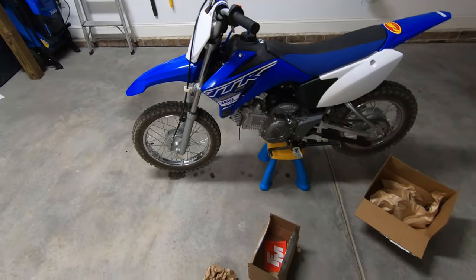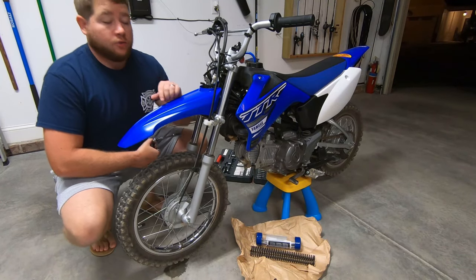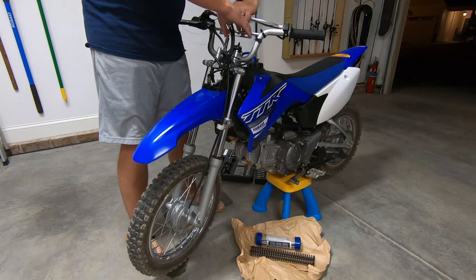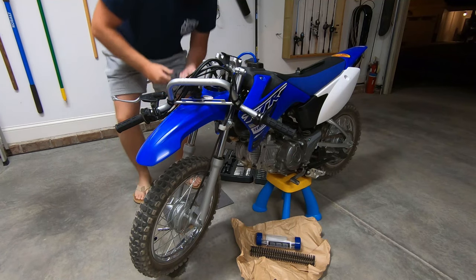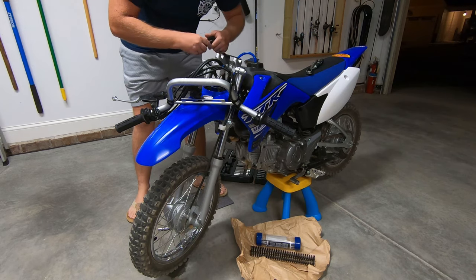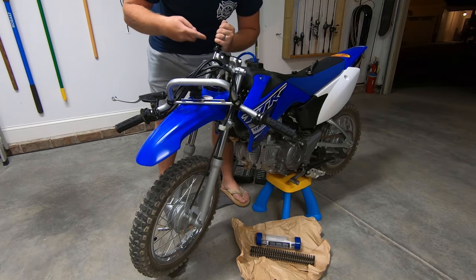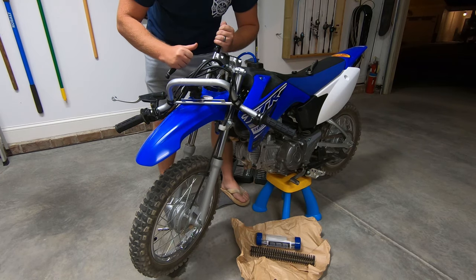I got my hands on one of those shocks really cheap off eBay, so we're going to try that. Tonight we're going to go ahead and get started on these forks. If you like the position of your bars as they sit, it's probably best to go ahead and mark them so you can line them back up exactly where you want them. Once you get the handlebars taken down, you're going to pop this rubber grommet off and there's going to be a c-clip holding this seal in the fork. You're going to push down on the spring and relieve that tension to pop that c-clip out. Keep in mind the spring is going to be loaded when you push it down, so you don't want the top of the fork coming up.